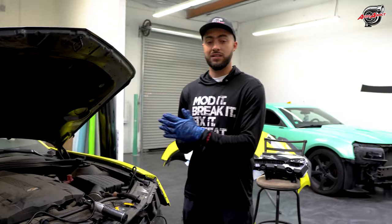What I like to do is open up the socket from the back. The first thing that I like to do before we install the bulb is switch out this rubber gasket to make sure it's pointing the opposite way so the fan is not being touched by this and interacting with the bulb. Okay, so as you can see, I reversed the gasket, pointing outside, so it's not interfering with any fitment issues over here. It's also a more secure way to keep the moisture from going in, so I like to do that.